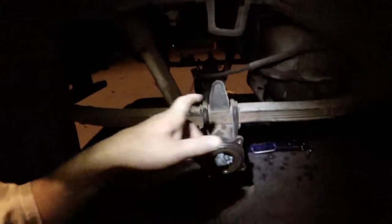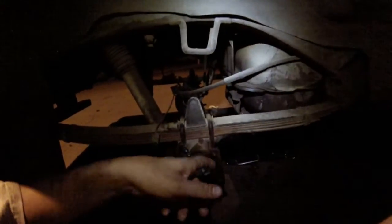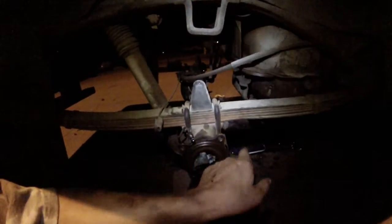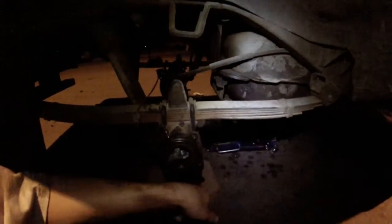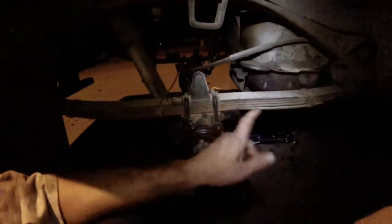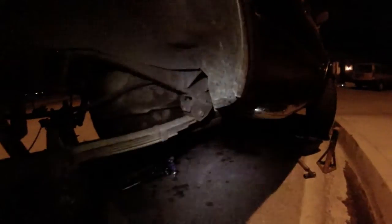Once the tires are off, and now that the drive shaft is off, the 4 bolts, you're going to need 2 14mm wrenches on that. The only reason I would recommend that you put the e-brake on is because that way the drive shaft doesn't move, and you can wrench on those bolts all you want and it's not catching all the gears and everything. So once the drive shaft's off, you can take that e-brake off, and make sure that you chock the front tires when you do, so you're not free rolling, because it'll come off these jack stands.